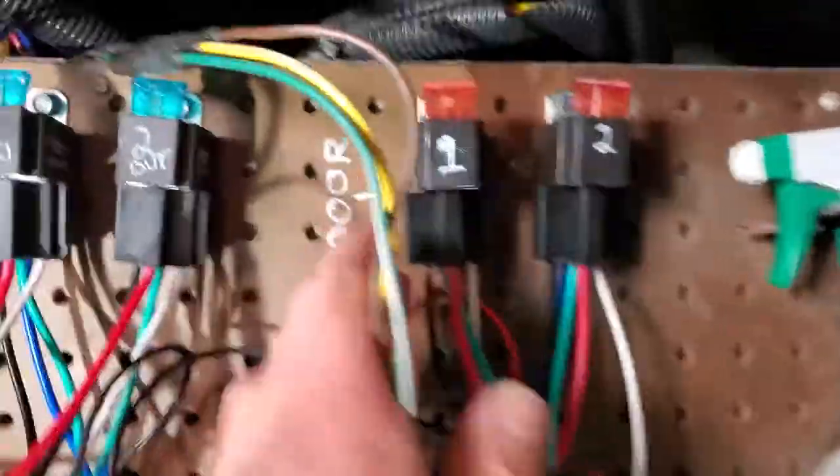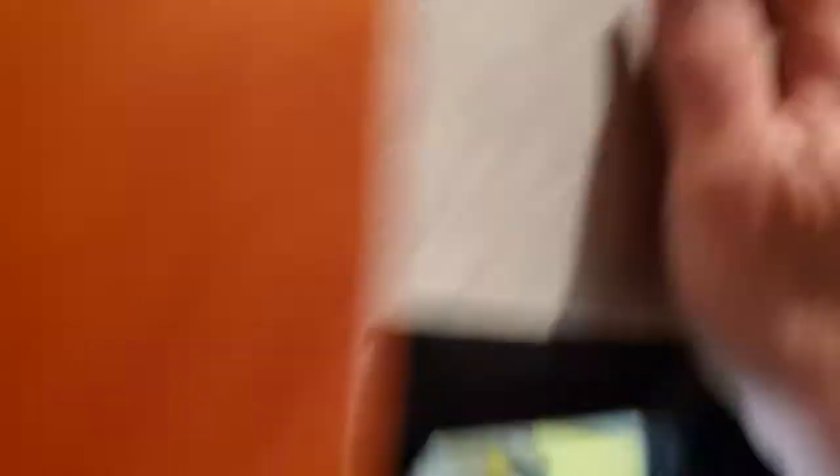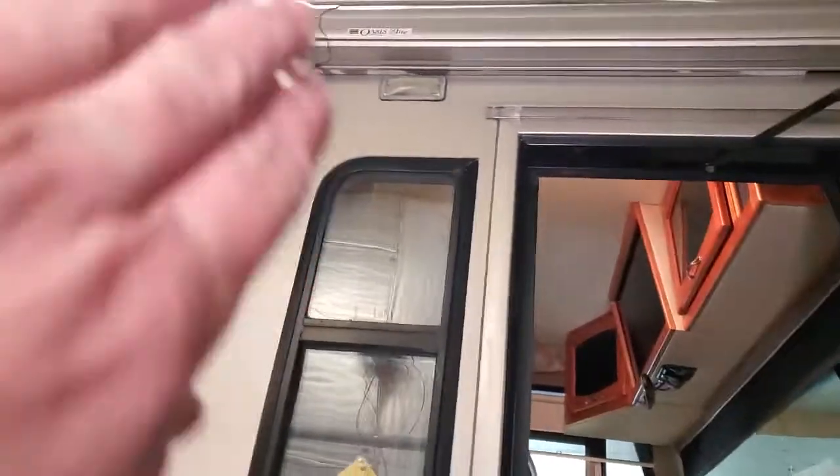All right, we're back. It's all fired up. You've got your 'in' and your 'out'. Let's go see what happens on the coach. I'm going to push extend — and then I'm going to push retract. There you go. And this here is broken — when it goes out, to an extent. So the one above the door has to be mechanically fixed now. Probably got something bent up in there or binding — the cap's got to be moved over a little bit.